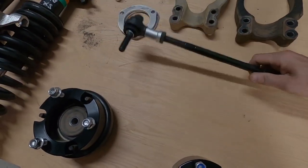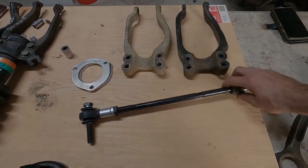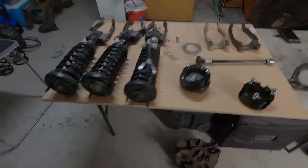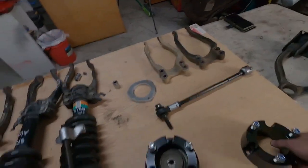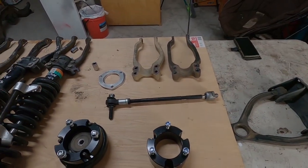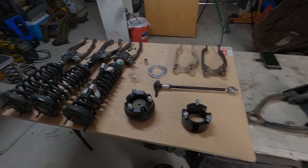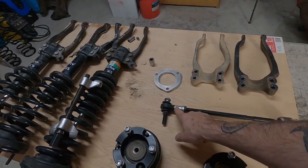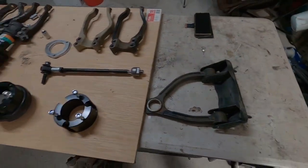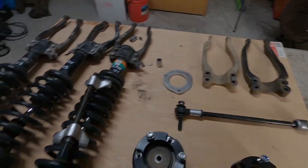The plan is to flip the steering arm to the top of the knuckle so it's straighter and eliminates bad bump steer over bumps - something I still need to fix. All this extra thick stuff and spacers in the rear opens up more issues. Keep it simple - once you go past basic lift it starts getting expensive. K-Mac adjustable mounts are nearly $100 each delivered, plus all the other custom parts. The more height you want, the more it costs.